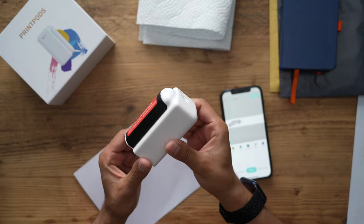And the last ink cartridge that I have is this one, the skin-friendly ink. So let's go ahead and swap out this ink, but right before you swap it out, just make sure to give it a clean. So I'm going to bring this tissue to showcase how this works. Make sure it's placed on top of the tissue. There we go, and then hit okay. It will start draining. Just hold it.